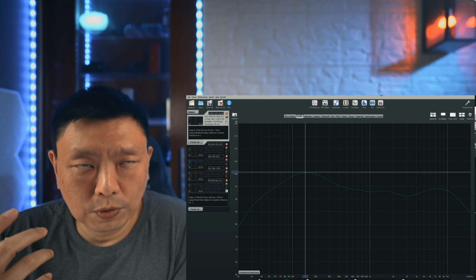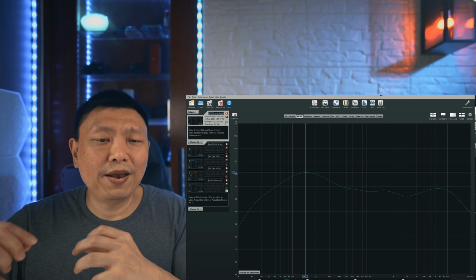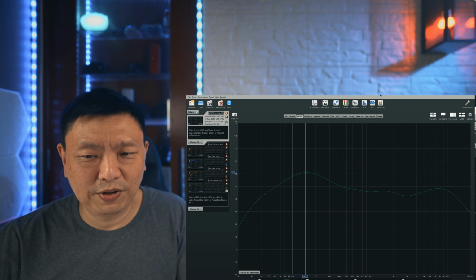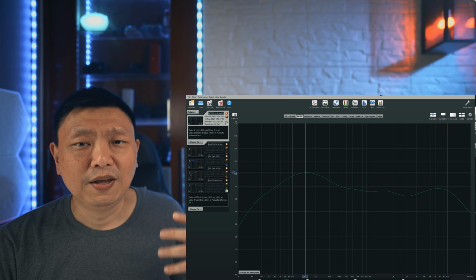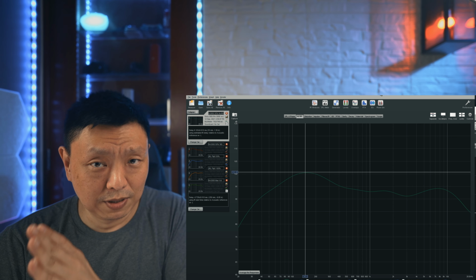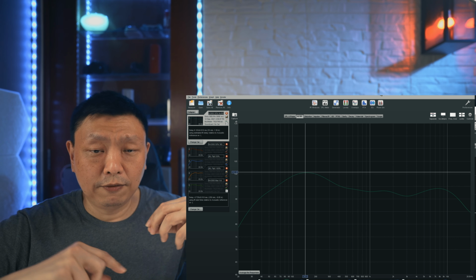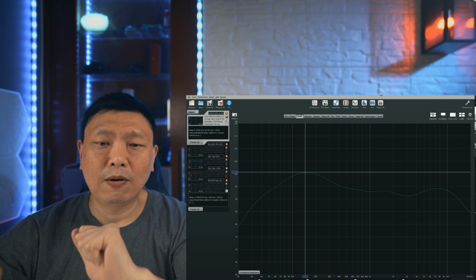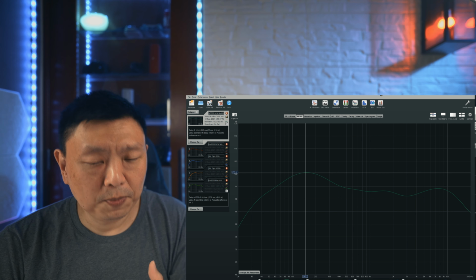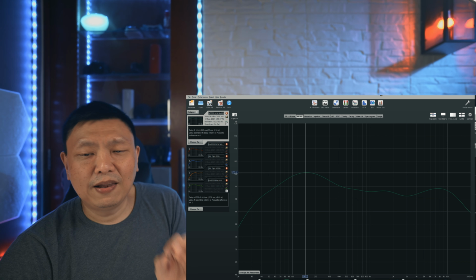as computational audio. So computational audio analyzes the sound that it is processing, and when there's a need for more bass, it actually tries to push it in. Now, computational audio actually plays a lot of tricks with all these frequency response sweeps, because a frequency response sweep means that you play 20 hertz, 21 hertz, 22 hertz, and so on, all the way up to 20,000 hertz. Now, what it doesn't allow is the Sony algorithm to look at the frequencies and try to pull them down or up. So the magic is kind of not applied in the frequency sweep. So when you're actually listening to this particular speaker, you will find that the bass isn't lacking at all.